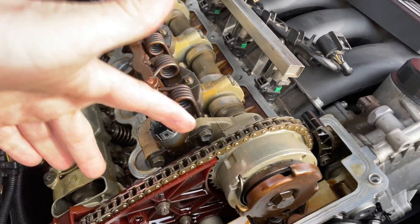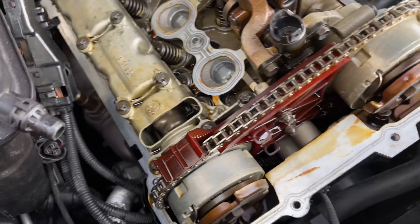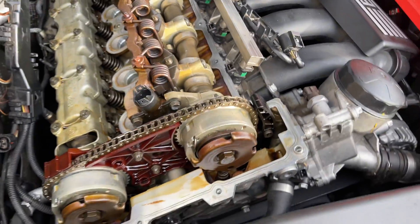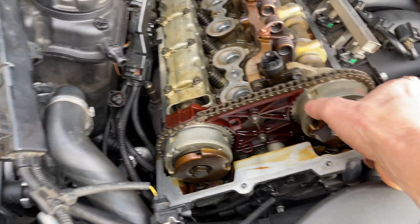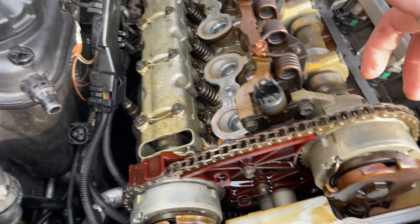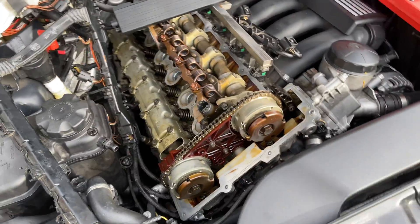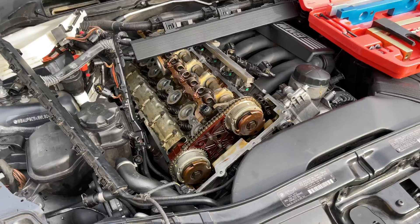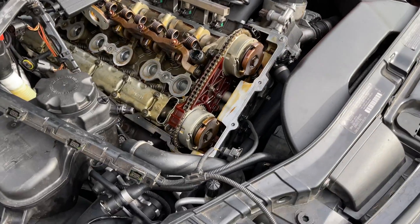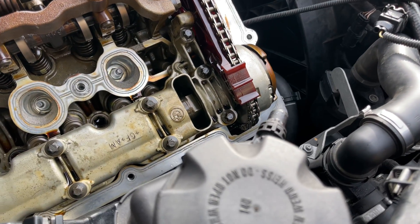What this tool is going to do is lock the cams. I've got to find top dead center first, but I've been turning it over just to get a visual inspection of these bolts. I'm going to turn it over, get it to top dead center, lock the camshafts with this tool, take these bolts out, remove these vanos units, extract any sheared bolts, and I have brand new bolts coming from BMW that'll be in tomorrow. I'm not going to film everything - this is just my story of my headache with this BMW.